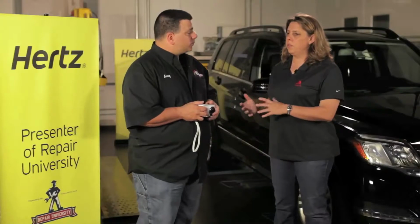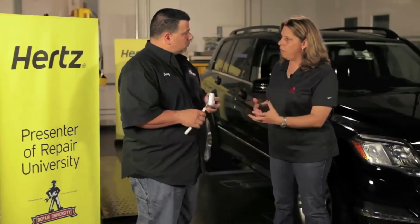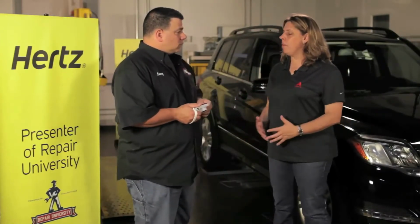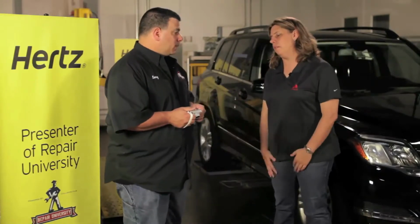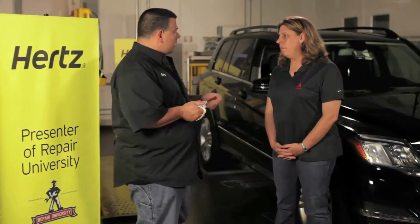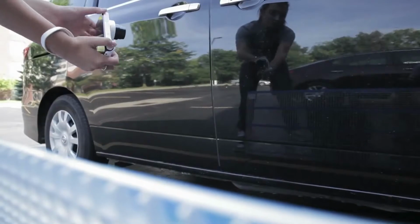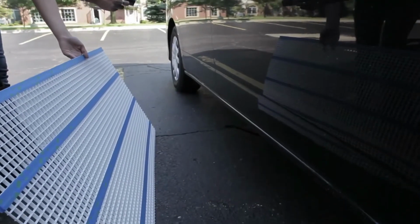Now, you mentioned a little earlier some tips about how we get the deformity in, whether it's graph paper or some people take rulers or whatever. What are some tools or some things that a shop can make or have on hand that'll help them show damage in pictures when the color of the car makes it hard? Well, I believe it's ASA, I think, has a free printable lined paper that they put out to their members. You can just get graph paper at any Staples or any office supply place. You can lay out your own Lexan piece of plastic and just lay tape lines on there. The idea is to give some sort of contrasting area, so when you get a reflection off the car, you can see where the line is straight and then all of a sudden it goes wobbly. You know that there's a dent there or something.